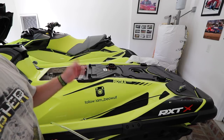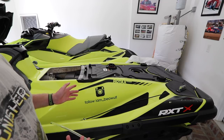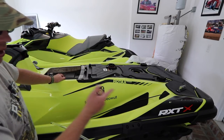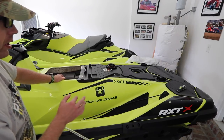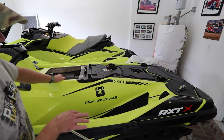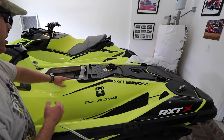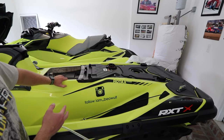You've got to check the oil. When you want to check the oil — I'm adding oil in and doing an oil change — you don't want to run this jet ski without the line you hook up to run water through it, which you can buy at the Sea-Doo dealer. Do not run this with no water running through it and don't let it run for a long time. If you bought one of these new or used, it came with a DVD and they'll tell you how long to run it for this process. Do not cold start it without having water running through it.